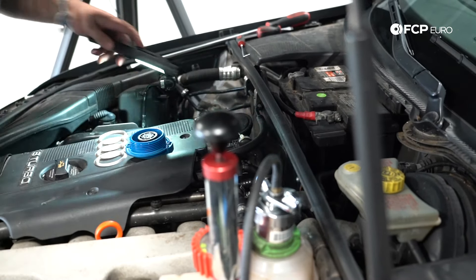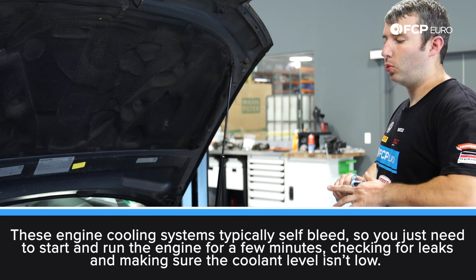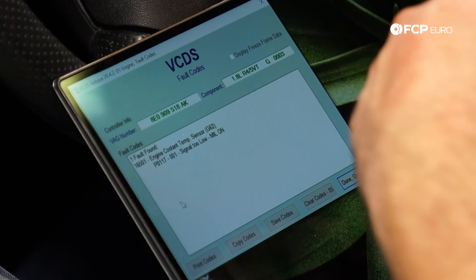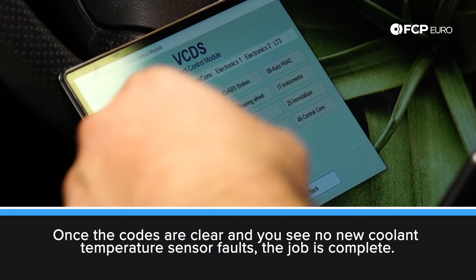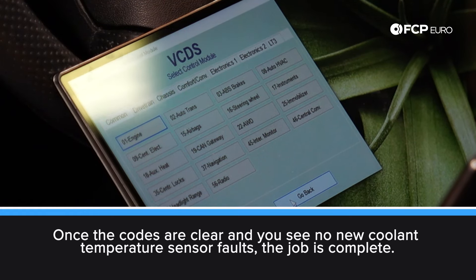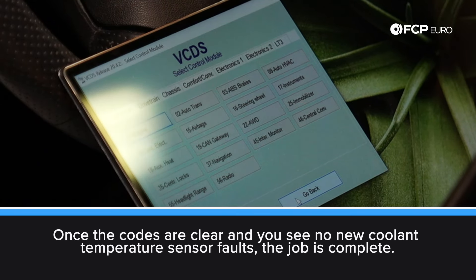So now we can wrap it up. Once you have leak-checked it, the next step is to bleed the cooling system while double checking the coolant temperature. Clear codes, then cycle the key. In conclusion, it's not that hard of a job. There are a few little tricks I've learned throughout the years, which hopefully you saw in the video. Luckily the coolant had not wicked through the wiring, so I cleared the fault and he's good to go. If you liked this video, give us a thumbs up, leave a comment, and subscribe for more content. Thanks for listening.